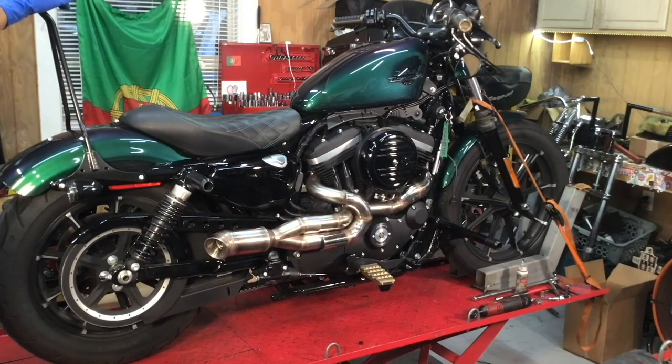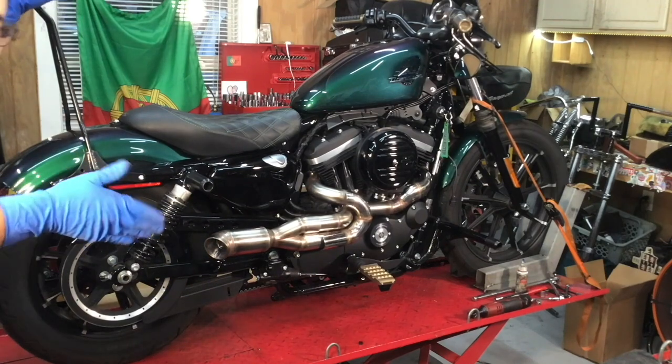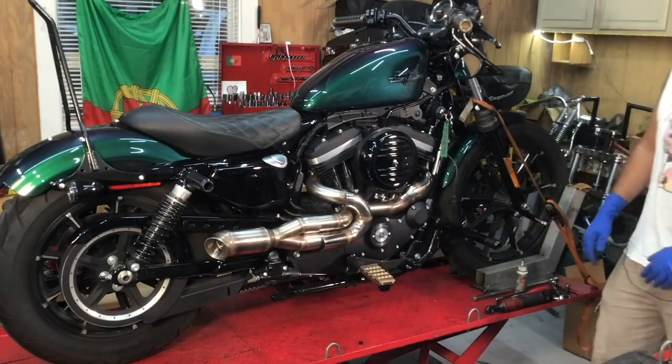I just build choppers and stupid stuff like that and ccafé racers. And I always had the concern of doing an exhaust mount. In this case, it has to go to the motor, not to any part of the frame, because the exhaust moves with the motor. Yep. So what we'll do is email Gallop, express our concern, and see what their response is. I'll take a picture of that exact spot. We'll have that answer from Gallop.